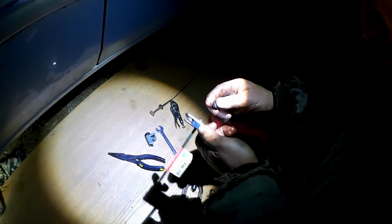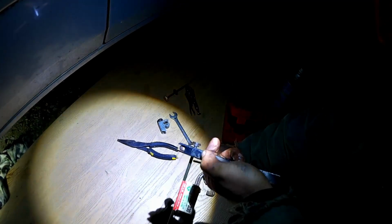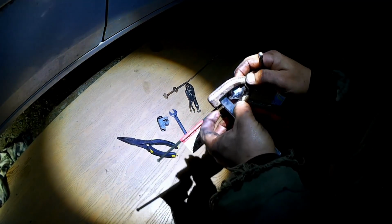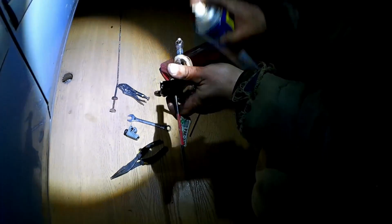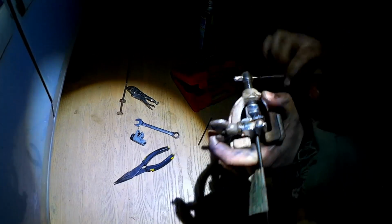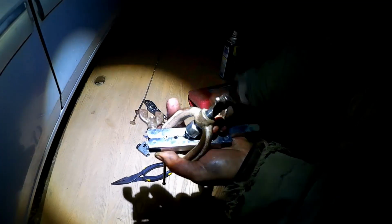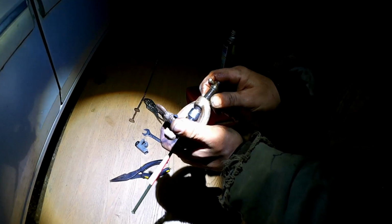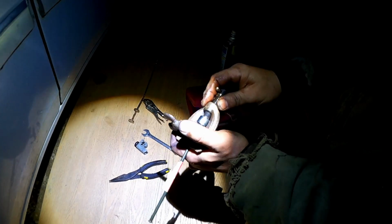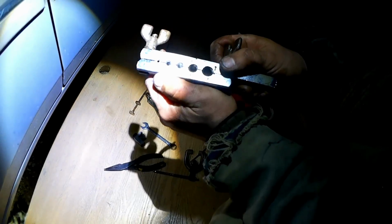After properly lubricating my flare tool, and with that clamped all the way down, install the little die there, which will crush the end of the tube, hopefully the way that we desire. Keep this stuff lubricated. Run this all the way down until the die touches the block. Now that is crushed like so. And you do the traditional flare part. Winding up with something like that.